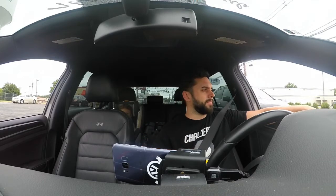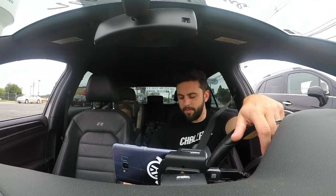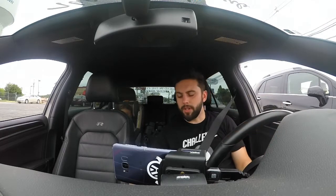So I definitely like that setting, and the fact that you can do that without some crazy tune or crazy valves sensing boost pressures that you'd have to hook up aftermarket. It's kind of nice to be able to do that right from a tuner. So yeah, that's boost by gear. You could do that in first, second, and third. If you are getting into crazy numbers, or if you're in a GTI with front wheel drive, you might have the need to boost by gear in second and third as well, rather than just first, like the all-wheel drives.